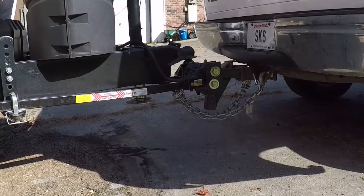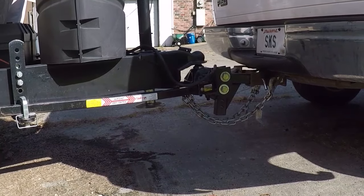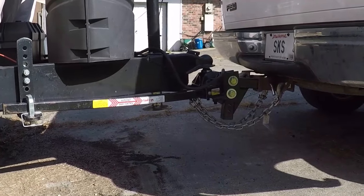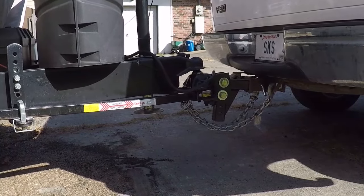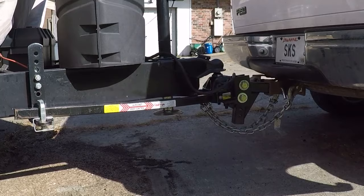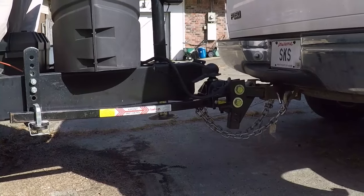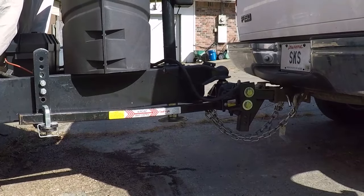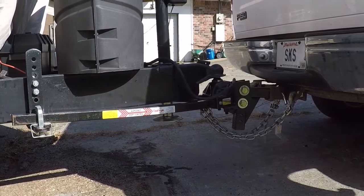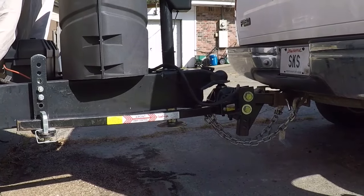After talking to forum members and seeing their comments, I started thinking I'm probably overloading this thing - which is when I took the measurement and confirmed it. Because it's overloaded, it's probably putting a lot of force in the pivoting area. You can see how angled that is, so when you're turning it's probably real stiff. I've actually noticed that if I don't lubricate it judiciously and it rains and washes out the lube, after going around a 90-degree corner the trailer will tend to not quite straighten out. That's probably one of the main reasons - I expect that to go away afterwards.